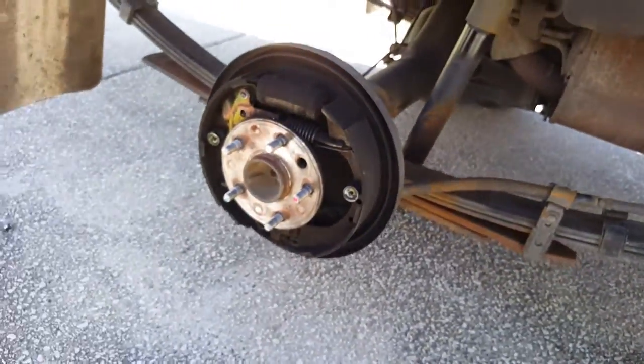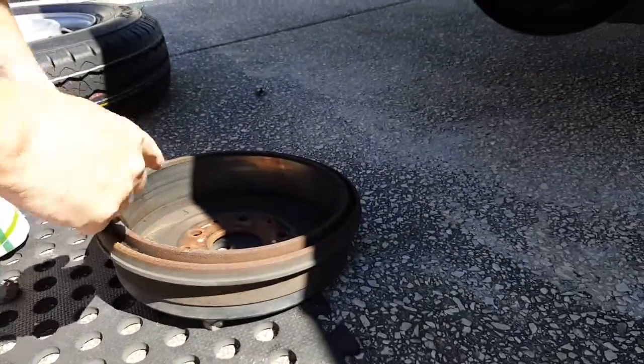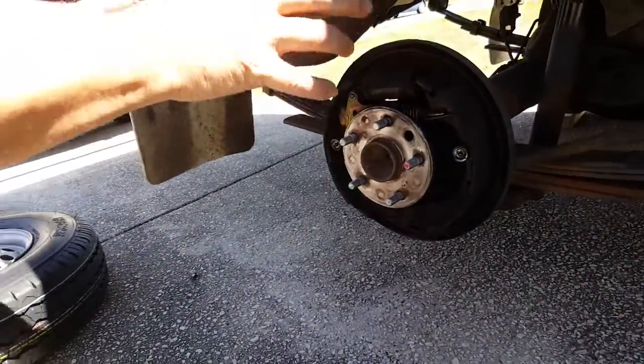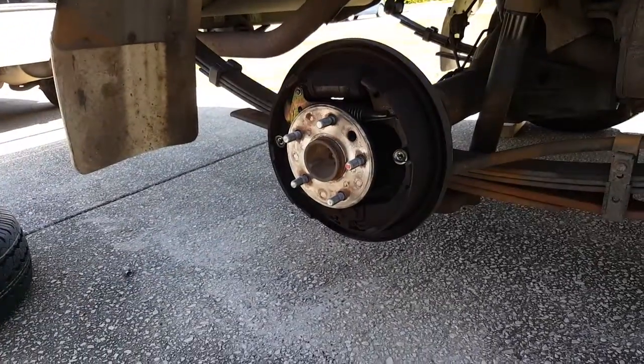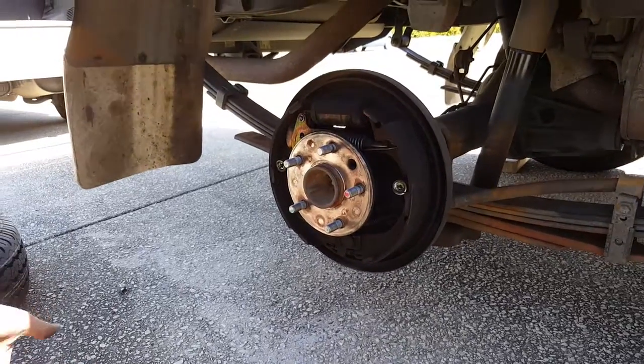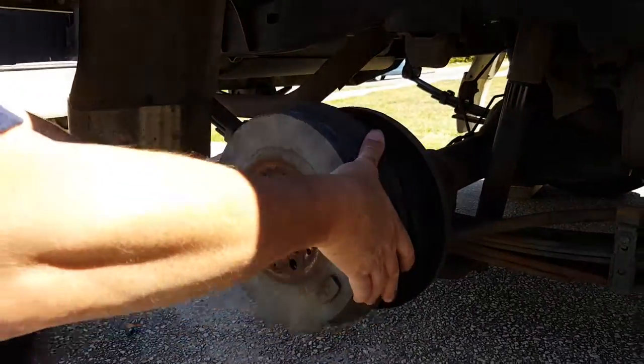So it's going to be due for brake shoes soon. You can take vernier calipers and measure the distance to make sure that it's under 256mm. But usually when I do brakes, I change the shoes and the drum at one time. But for right now, I've got to drive this on Monday, so I'm putting it back on.